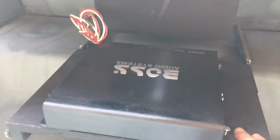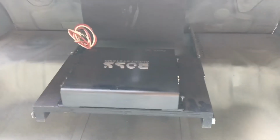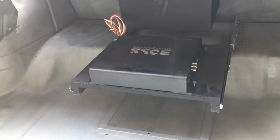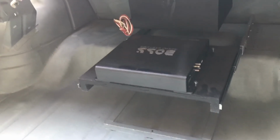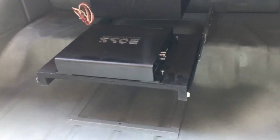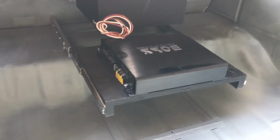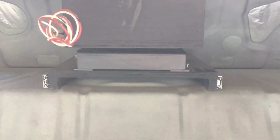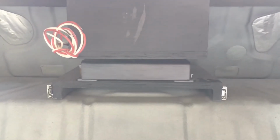Under the speaker box, you see there's a set of drawer slides, and that is going to be where the amplifier lives. And the point being is that climbing in an A-body trunk sucks. Working in there is near impossible. I did it with the first Chevelle and no fun. So I decided to go ahead and do that so that I can hook up everything with that slide pulled out like you see it, and adjust levels and things. And then once I'm happy, just slide it back in and either tether it or do some kind of block so it can't slide out. But I thought that was a pretty slick installation for long-term, not having things in the way in the trunk, but still leave it somewhat future-proof and serviceable if needed.